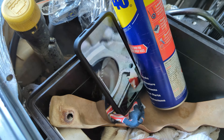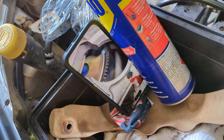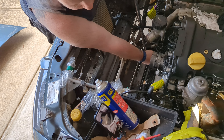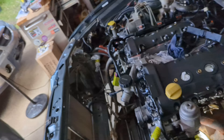Once you've done that, get him to turn around again to the next bolt hole. I might have to realign the camera so we can see what's going on down there. Just turning it again — there we go, almost. That's done, just chuck that bolt in. Go around one more time on each one and tighten them up, and that's how you remove or put back your flex plate to your torque converter. Like I said, this is the easiest part of the whole thing.